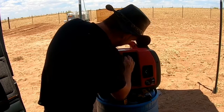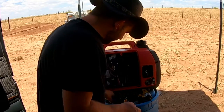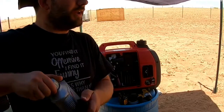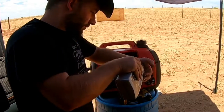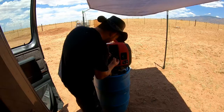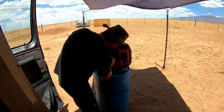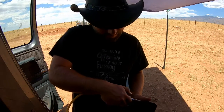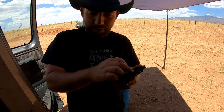So we're just going to take and put that right back in there. Your hands should be a little oily after handling that because it is an oil filter. It's a wet filter. Same thing with that guy there. Matter of fact, I've got a little bit of oil left over. All right, we've cleaned our filter up, our pre-filter. Put the lid back on, and even though there's really nothing around it, I'm just gonna give that gasket just a little quick blow.